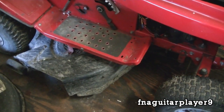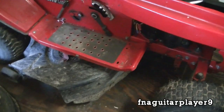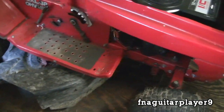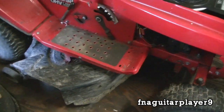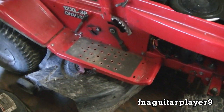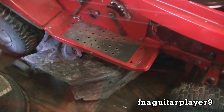I used to take the blades off and sharpen them right before I cut grass for the first time in the spring. But I stopped doing that in the last few years because there's always a lot of small twigs laying around the yard. You can't always pick them all up, and you don't want to dull your blades the first time you cut it. So I wait until after the first time I cut to sharpen the blades.